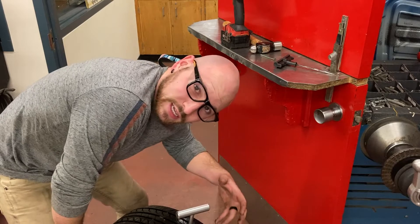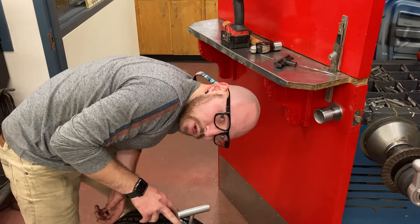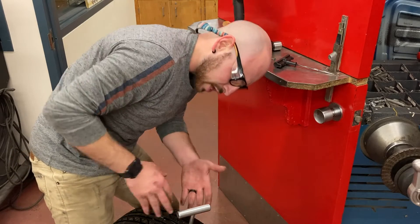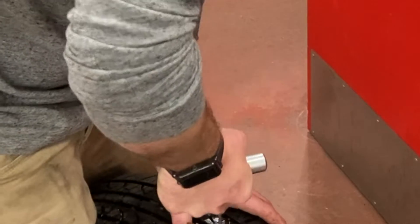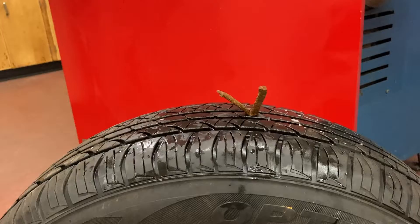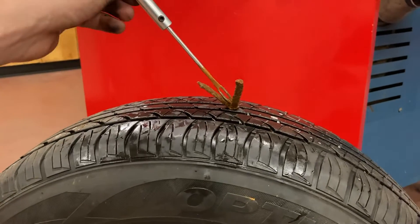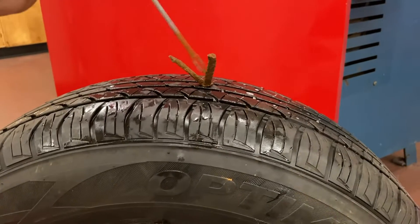Install the tip of this tool into the hole. Once you are red in the face from pushing that into the tire and you can see that it's in there pretty good, you simply need to pull the tool out and it will cut the patch and leave it installed in the tire like so. It might have been kind of difficult to see — I realized it was kind of out in the last clip — but basically I was able to insert that into the tire and then pull it out and leave this sticking out.